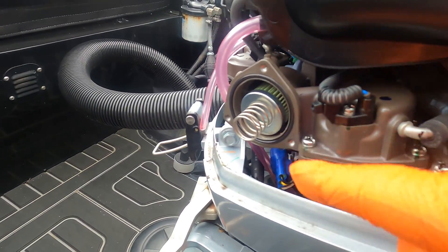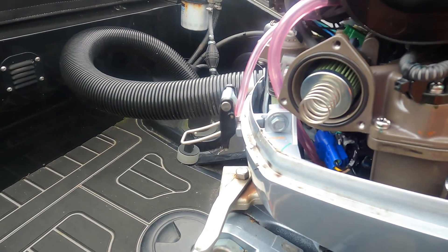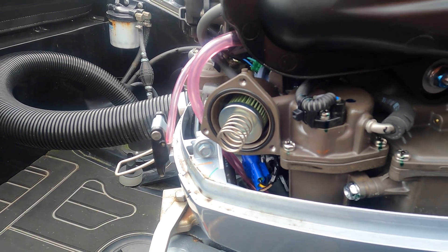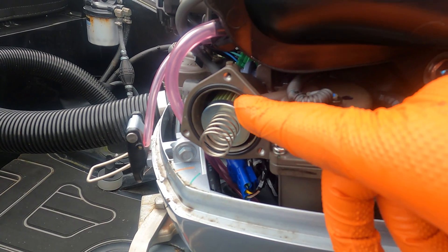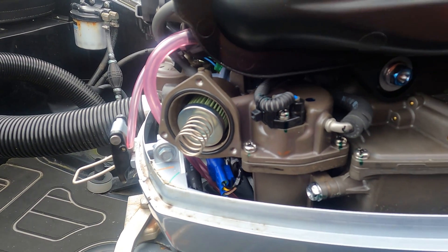Just had a correction — I said it didn't come with an O-ring, but it actually does come with an O-ring. I just found it in that bag; it was under another part in the kit. It's obviously always good to change O-rings because when you've got a flat face like that, it does crush the O-ring, and over time it wears down to the point where you have no seal in effect. So it's always good to change O-rings.